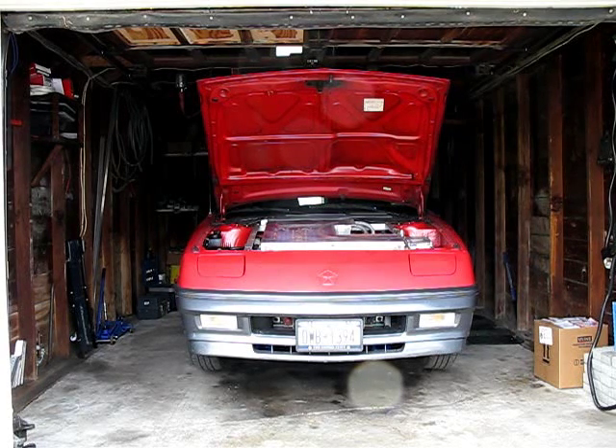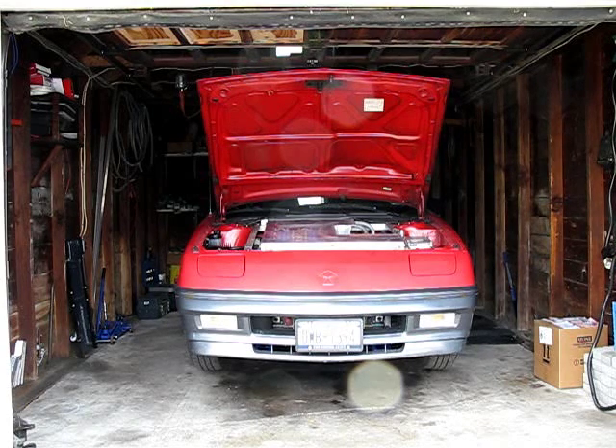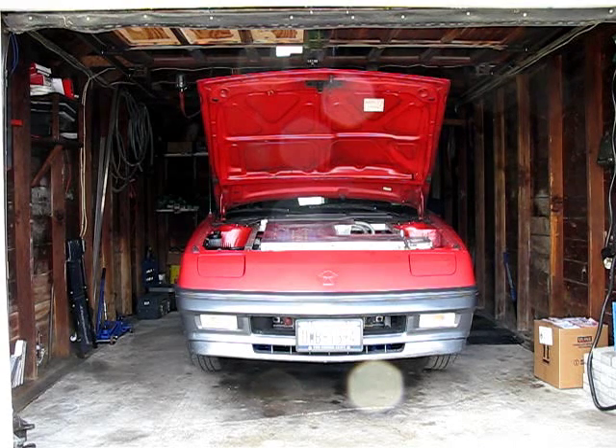Sort of a metal-on-metal grinding, and I'm not really sure what it is. So up on the jack stands it goes, and the plan is that I'm going to pull the motor and basically spin it when it's not connected to the transmission or the drive shafts or any of that kind of stuff, just get it down to the bare minimum and see if that noise still persists. My guess is that it's actually the bearings in the motor — perhaps they got some contamination in them, or maybe due to the rapid heating and cooling driving it in the wintertime with all the negative temperatures, with the commutator heating up a lot, coupled with salt and slush and grit from the road. I'm sure it didn't do it any favors.